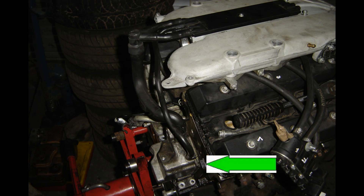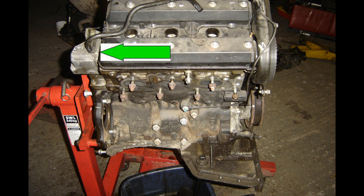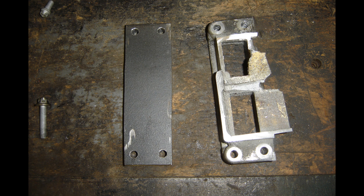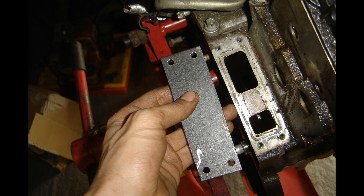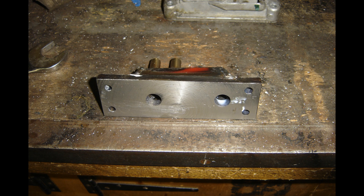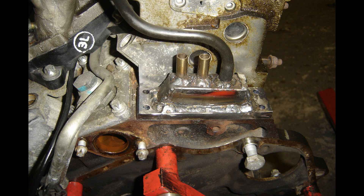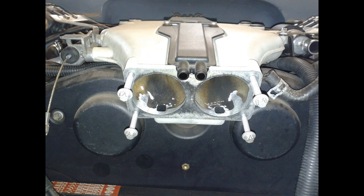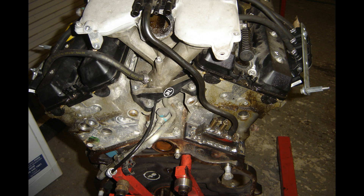You can see in the lower half of this shot the engine rebreather — crankcase recirculation arrangement. It's a separator where oil can drip back into the block and gases come up into the back of the inlet manifold, but as you can see it sticks out further than the back of the crankcase. I was keen to change this to get the engine as far back as I could. I remodeled it — you can see I made a pattern out of steel which bolts down to the same location with sealant — and made this little thing that looks like a ship but works perfectly. Under low throttle conditions you don't get much blow-by, so the small pipe that is fitted suffices and goes into the inlet manifold directly behind the throttle body. The two larger pipes handle blow-by under high throttle conditions. They connect to fittings on the manifold and go forward to in front of the throttle, so at full throttle the partial vacuum pulls gas through from the crankcase.